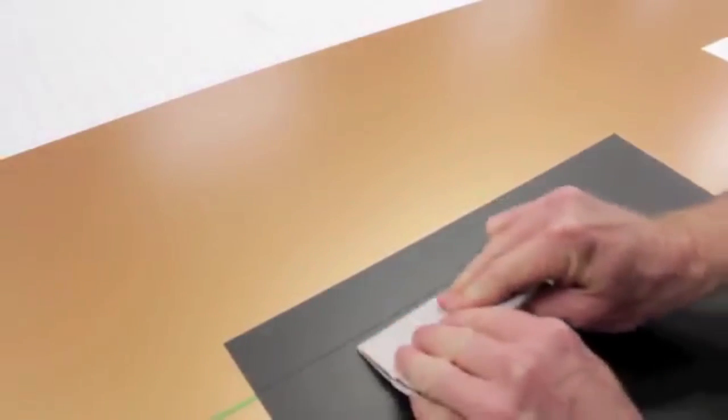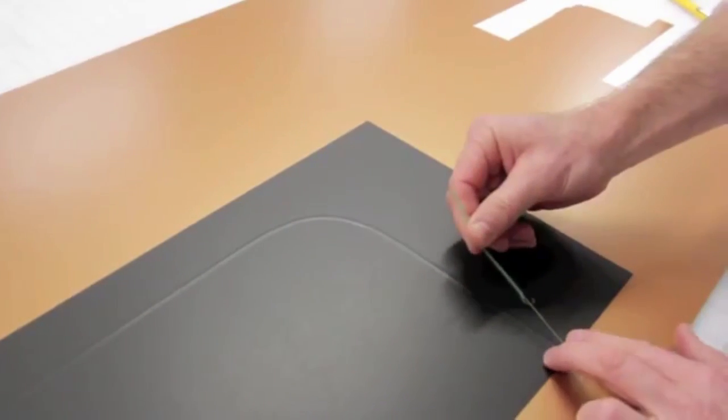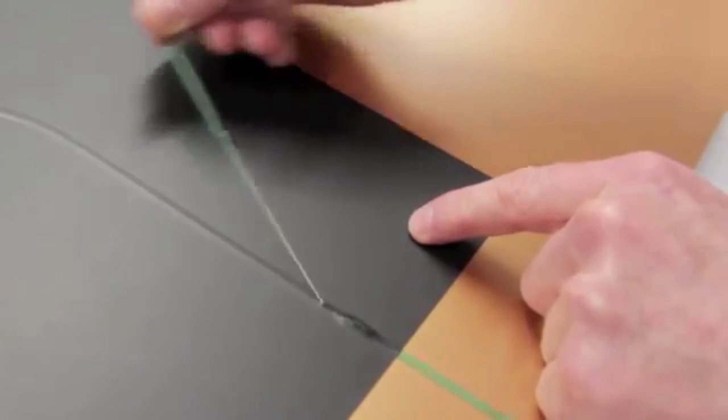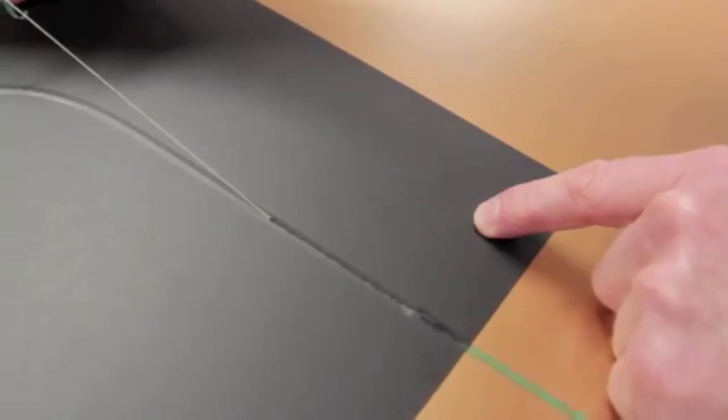A note on knifeless tape. It's a great tool for not cutting your paint when cutting vinyl, but it's another finesse skill to learn. I didn't have as much luck with the knifeless tape as it kept bunching up on me, but I think that was an error in my technique rather than the tape. When it did work as advertised, it was great, cutting a clean, crisp line exactly where I had marked.